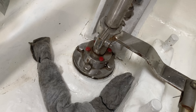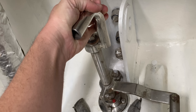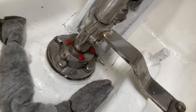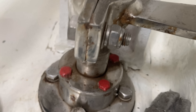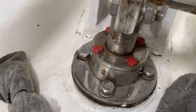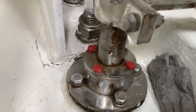I think what might well be happening — the actual steering is still perfectly smooth, I can even move it with my hand here with almost no leverage, so the actual steering system is working nicely. But there is, if you look very closely, a little bit of movement in there, and I'm guessing that the packing in this very basic setup is probably past its sell-by date.